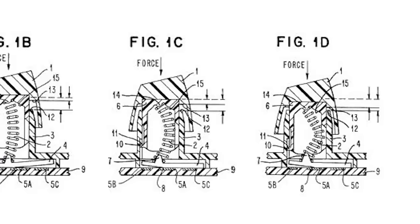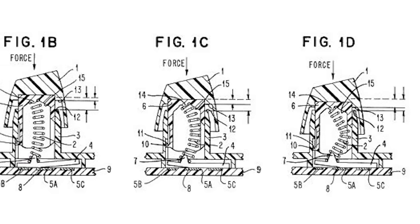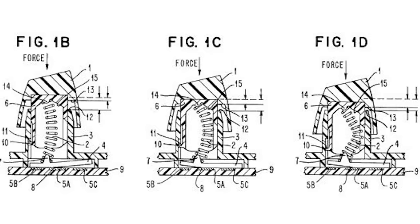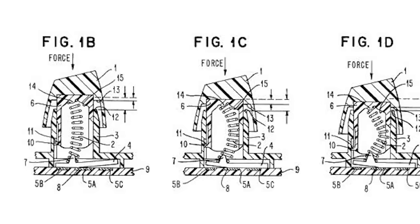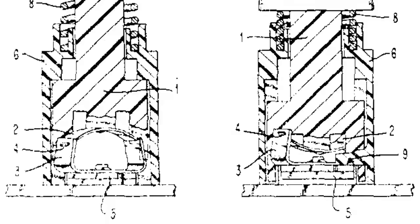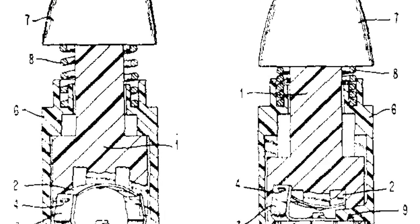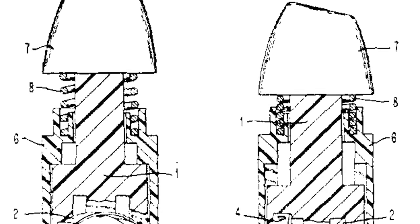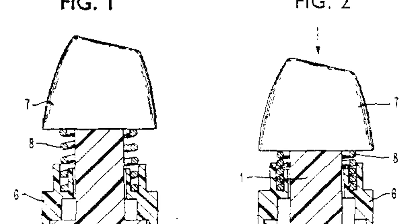When you push the key down, the key makes its tactile sensation known before the key bottoms out. The spring buckles, which creates that sensation. You feel it in the tip of your finger. It's a very satisfying, almost electric sensation. The beam spring keyboard design is pretty similar, although the sensation when the key bottoms out is perhaps a little less satisfying than what you experience with a Model F or a Model M type key switch.